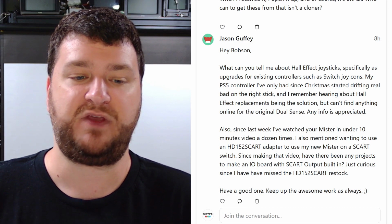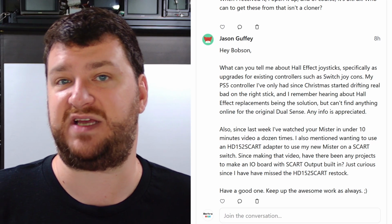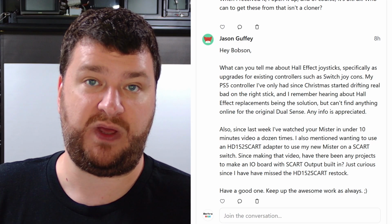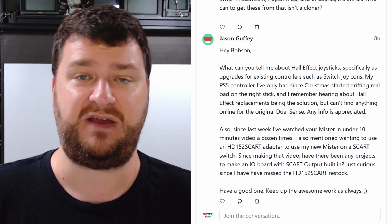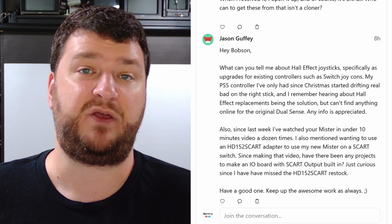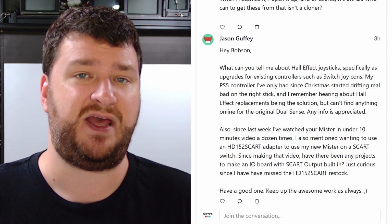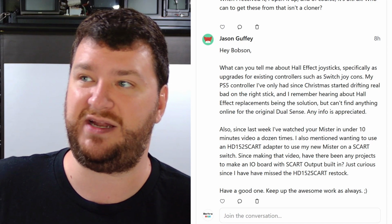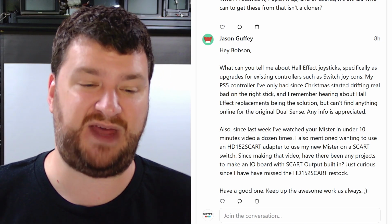The only issue is, I'm assuming that you're probably going to want to mess with this on VGA monitors as well. So if you wanted that case, you could just use direct video, or direct video with the line doubler, or you could just simply use an HDMI to VGA converter, that same Ranky one that I mentioned last week. You could definitely do that. And in fact, if you wanted to, you could even use that exact solution to have your SCART cable on an RGB monitor and your VGA cable with the line double mode on your VGA CRT monitor. You could certainly do that as well.